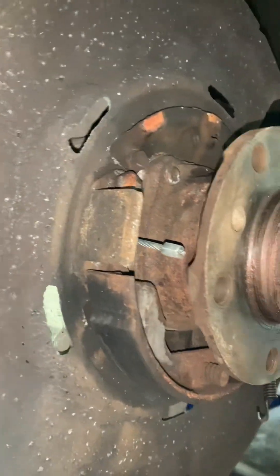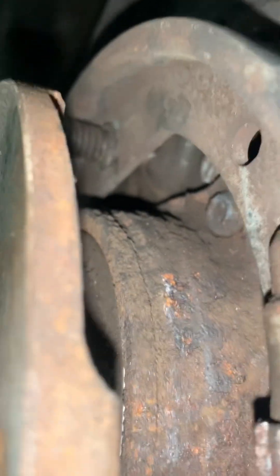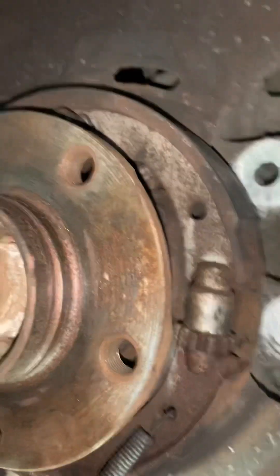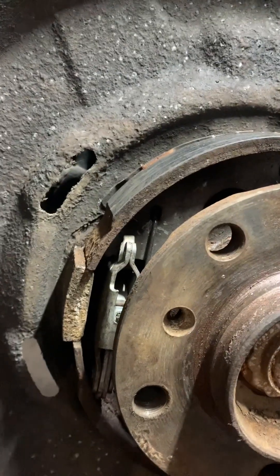Now it's just the job of rebuilding all the handbrake shoes and getting everything good, then putting the discs and pads back on. The hole the spring retainer needs to go through - you go in, turn a quarter turn and it locks in. Now we've got to put all the springs back in place and lightly adjust the adjusters. The handbrake cable is sticking through - we are getting there.